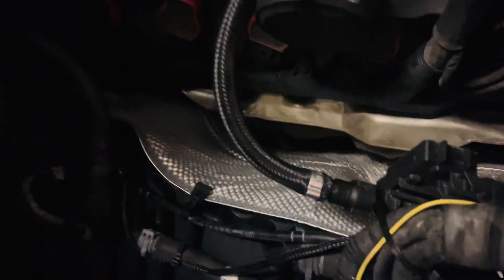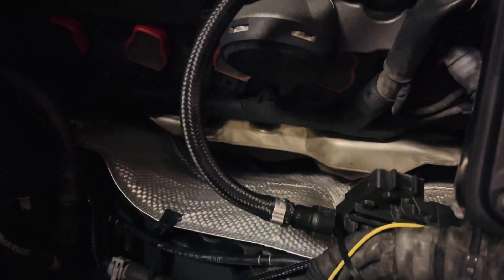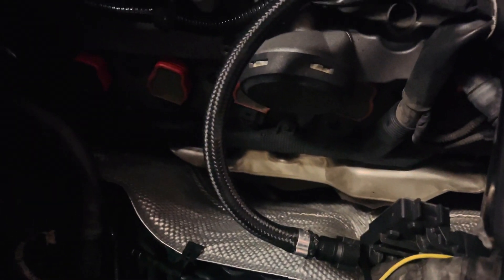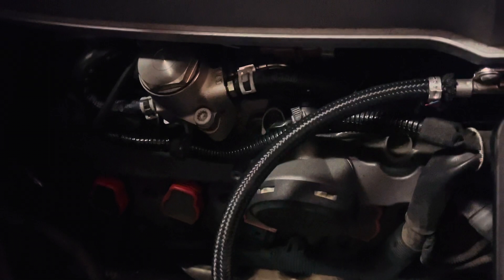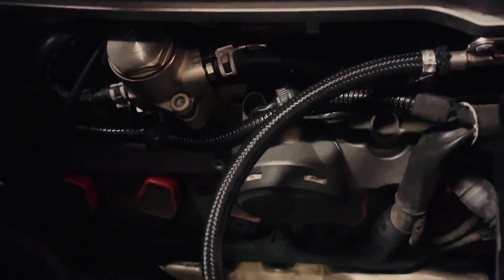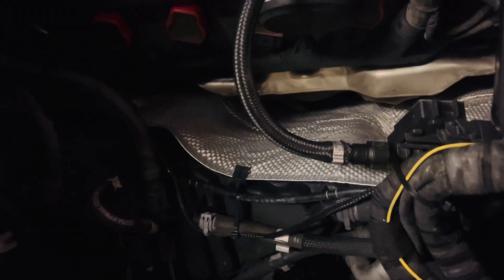I'm just going to get in here and check it out. So there's the actual sensor right there. There's the upgraded fuel line that I've installed. It had a rubber hose on it and I really didn't like that. I had a couple of issues with it breaking, fraying, and cracking, and I didn't feel like I could trust it once it had been moved or taken off. So I just went ahead and upgraded to a braided hose, used some doggy clamps to get it back on there, and I left the carbon fiber paneling piece off just so I could make sure it wasn't leaking or anything like that.